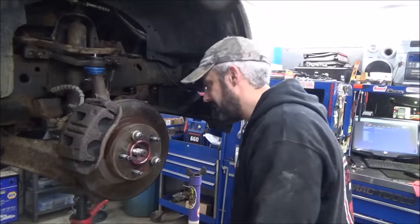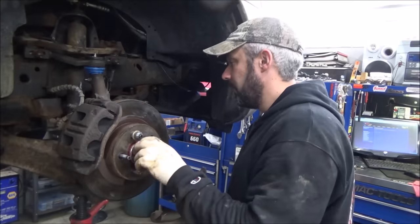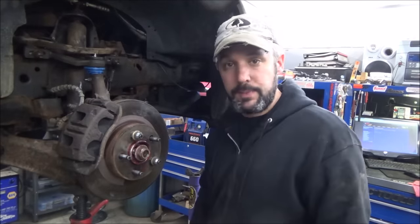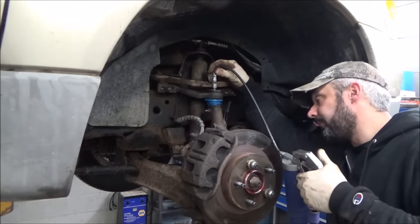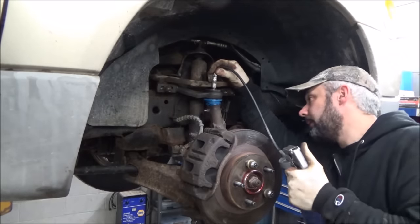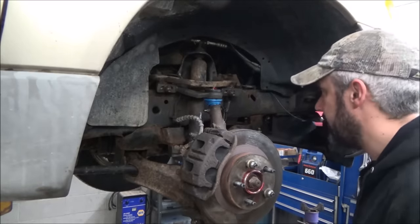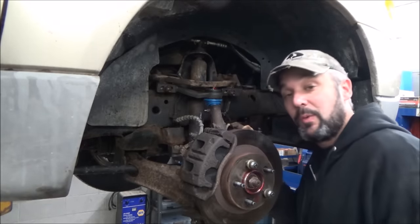All right — now we just gotta torque down our axle nut, grab a torque spec, make sure everything is torqued to spec, give it a little shot of grease, and swap out our sway bar links. That takes a lot of grease — just starting to move the boot now, so I'll leave that one there. These can't take very much. I think I just proved the theory why it says mount this side inboard — you can see that's where a little bit of the grease oozes out the back.